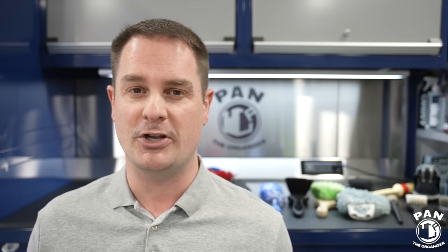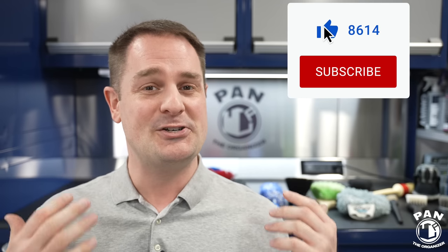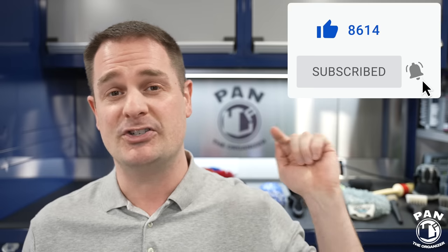What's the best wheel cleaning brush? You guys are going to find out in this video because behind me I have a bunch of different brushes for cleaning wheels and tires, and I'll be going over the features of each one. I'll also be giving tips on how to make your future wheel cleaning routine quicker and easier, and sharing tips on how to prevent flash rust or surface rust from happening on your brake rotors when you're done washing your car — because that surface rust flies onto your wheels and paintwork. It's a jam-packed video, so let's start right away.